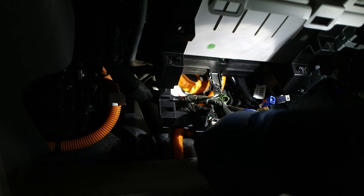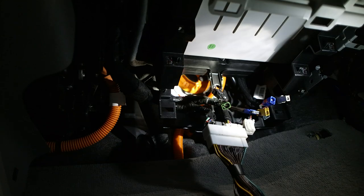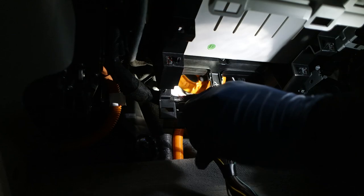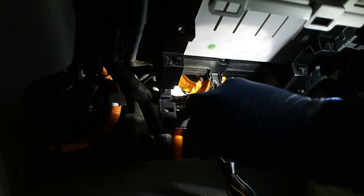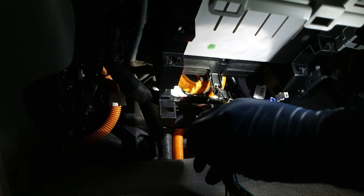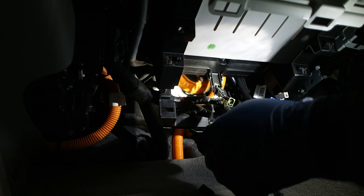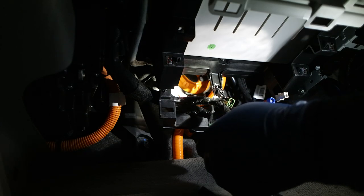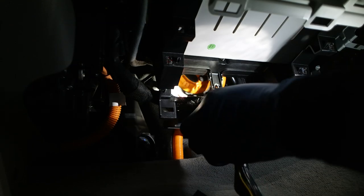Rear left hand door speaker should be purple and black, purple and yellow. And I need to get, this is in the right so this will work. So purple and black. And then purple and yellow. So the rear speaker's right. This is looking pretty good. And then the one right below that is the front left, which should be brown and white because they're paired up. Brown, white.